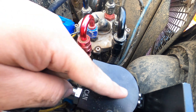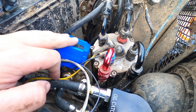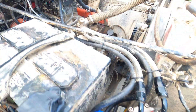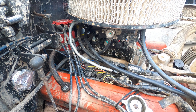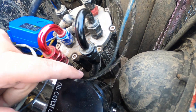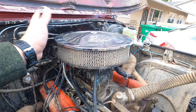When the car is on, I have the ball valve connected to the same trigger as the fuel pump. So when the fuel pump is running, the ball valve is open — the fuel pump only runs during priming and when the car is operational. The vent goes to the ported intake of the throttle body system, so any light throttle will pull vacuum and idle will just vent into the throttle body. When the system is off, the ball valve closes, which results in the fumes going through the charcoal canister and venting into the filter cavity area.